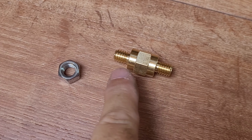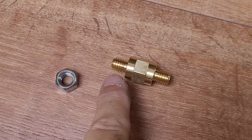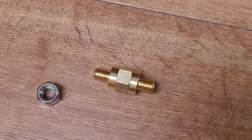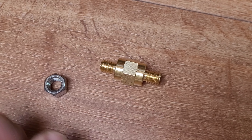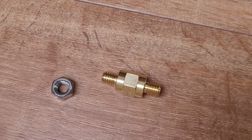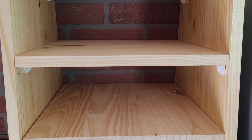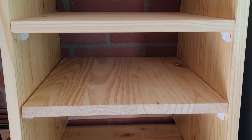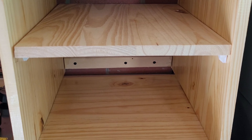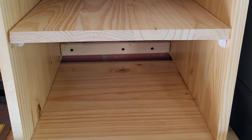If you're not familiar with these accessory studs, one end passes through your stock battery cable and into the battery itself making the same connection as before, and it gives you a threaded end on the other end so you can attach your accessory. In my case that's where the 4 gauge cable attaches on the DC to DC charging portion of my solar system, and then you just put the nut on over the terminal.